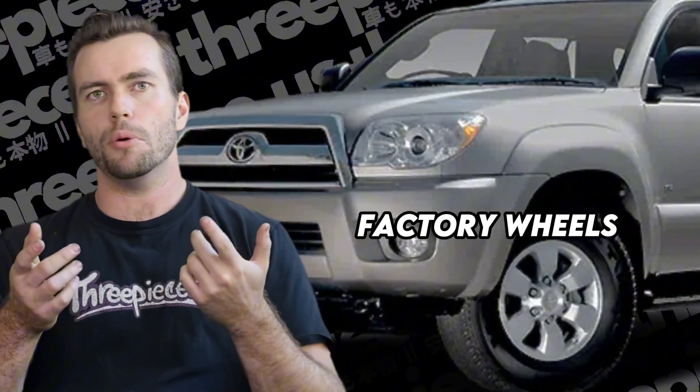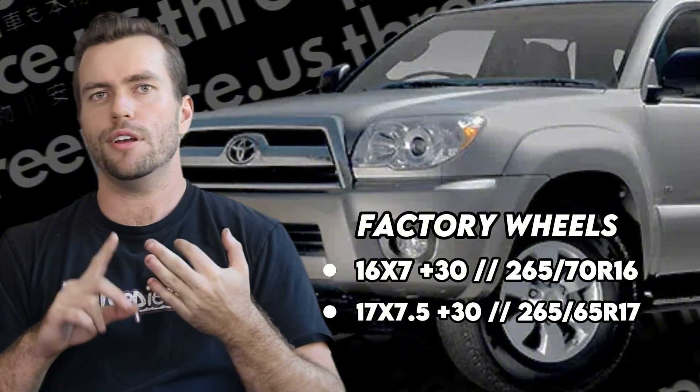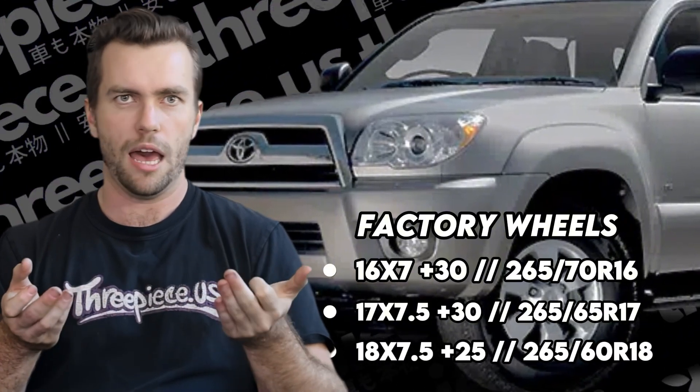You're not here to learn about stock wheels, but it's good to compare aftermarket to stock specs so you can anticipate how much clearance you're going to lose or need to add. There's nothing worse than ordering what you think is a direct fit just to have it rub like crazy even driving in a straight line. Your factory wheels are going to be one of the following: either a 16x7 +30, 17x7.5 +30, or 18x7.5 +25 — so basically all the same with different diameters. You get something between 16 and 18 inch from the factory, with around the same diameter tire, 30.6 inches regardless.